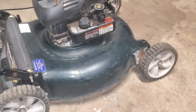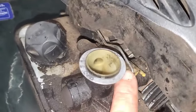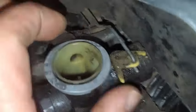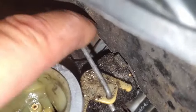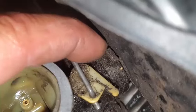Let me try to find that spring. There's a cool little point of interest here. When someone reinstalled this carburetor — they took it off, put on the new air cleaner and filter — when they got it back on there, they got that little arm on the other side of this detent over here. So this arm should be on the other side of this, over here.